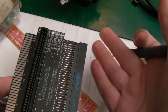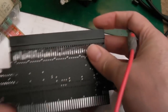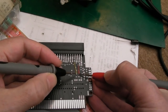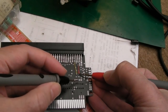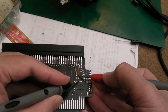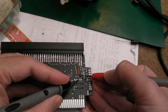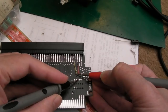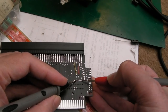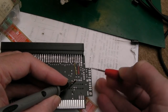So as you imagine the Amiga motherboard here, we're dealing with the third one on the underside and the fifth one. But if we just test from this side of the +5 here to these two positions, hang on, yeah, you'll see the left hand pad there, we've got a short, so that's the 5 volts. The yellow one, I'll do the same thing here, goes to that one, dead short. So these two pads must be the grounds, they're joined together. That's the ground down there.